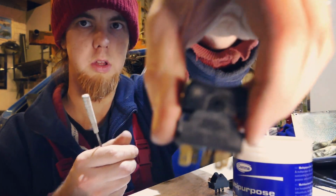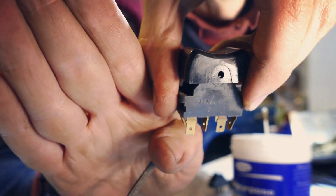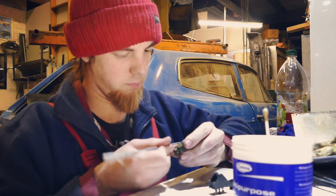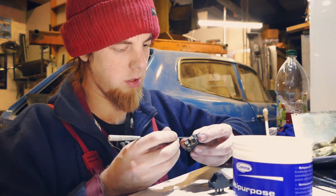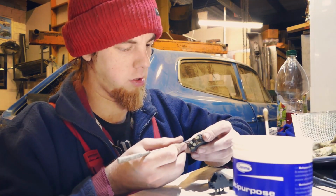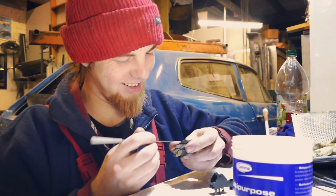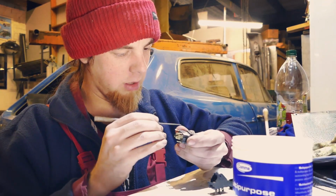No more than that much. You can see the tiny, tiny peg in there. If you lever it any more than that, you'll snap the edge of it. Mind you, once you get one side started, you can put the other side back on and then start to lever it off again. Come on. Come on, the other ones are easier than this. I'm starting to damage the switch now.